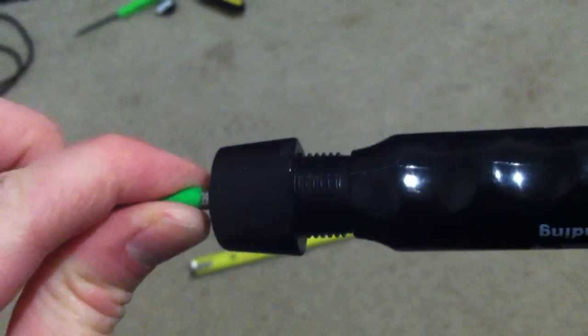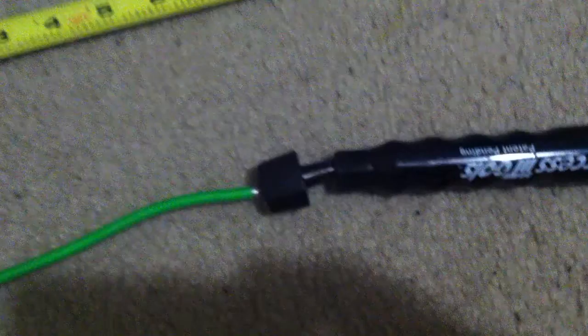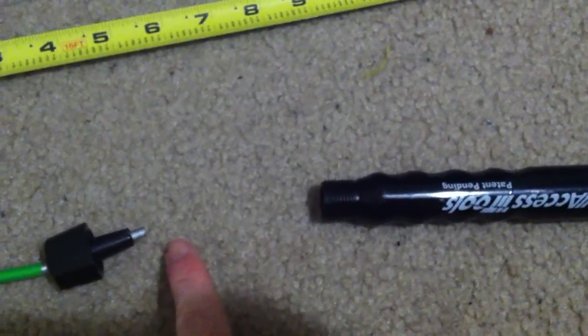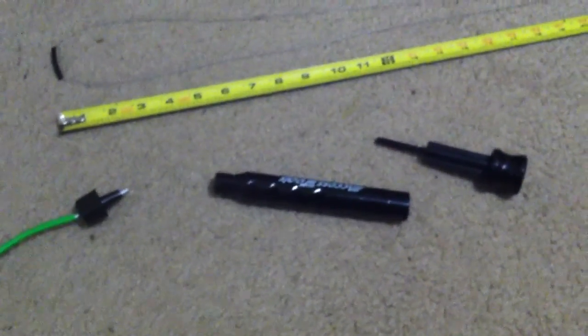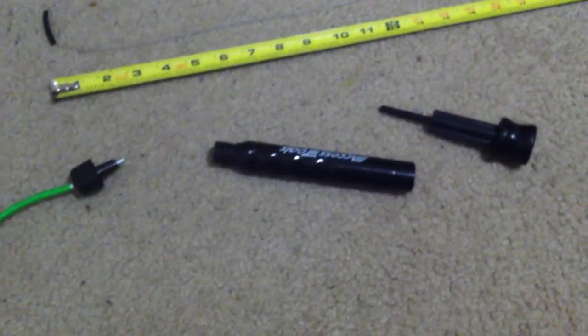And then after you do that, you unscrew this middle part right here, which you should be able to unscrew by hand, and you pull it apart. When you pull this part out, usually there is a wire in between here that you pull out, and this top piece isn't connected anymore, so you can just pop it right off. Those 3 pieces are then separate, and that makes it a lot easier to rewire and put your new wire up in there.